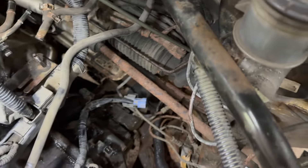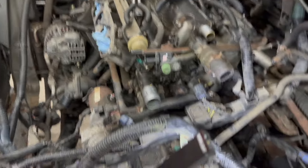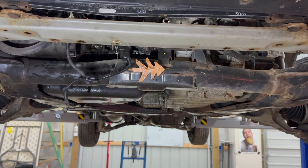Got the wheels off. I'm gonna disconnect this engine mount — I think four bolts at the bottom and it should start coming out. I can sneak in and get that one AC compressor bolt out, or if not I'll just discharge the AC system. Got that one with a wrench from up top, but that one in the back — ain't no way — this whole thing is going to have to flip backwards.